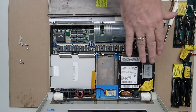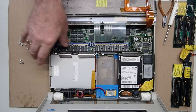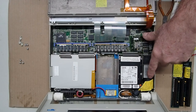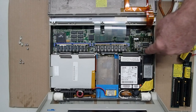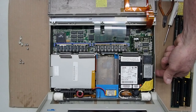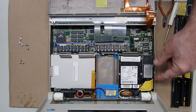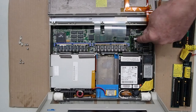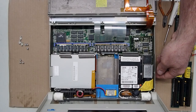But underneath here, that's kind of gone through and exposed the back area, that if it wasn't just as simple of adding or removing SIMMs or something else like that, then you would have to have this out because this is where the modem board goes. It's treated as an option, but it's on so many L40SXs, and then there's the two RJ11 jacks here for the line and phone connection of that. And then there's a less common serial port board that goes in here as well, and it has that DB9 connection over here on the side.